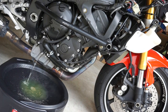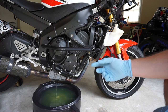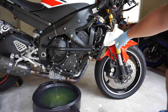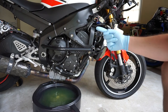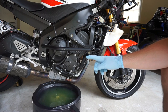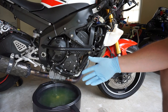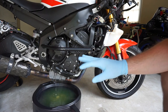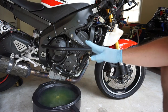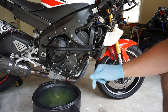We're just going to let this drain out. You can see the water is still a little bit green because we let it cycle through the system. I've gone ahead and emptied out the reservoir as well. I'm going to run distilled water through the entire system one more time, but I'll skip showing that part again since it's the same process. Do what we just did with the distilled water one more time — let the bike heat up, cycle the water through the engine — and then come back for the engine ice.